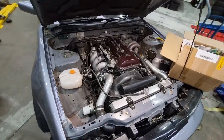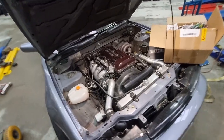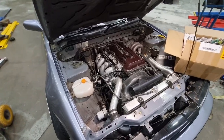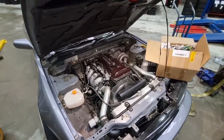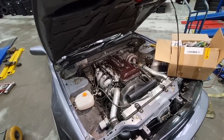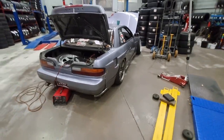The alternator was doing something, I should say. It wasn't like it wasn't doing anything. Idled, it was doing nothing. It would literally start misfiring if I idled for 30 seconds and start breaking up to the point you couldn't drive off. Once you revved it up to like 4,000 or whatever, we maybe got like 11.8 to 12.1 volts in the car. But yeah, not ideal. Anyway, she made it through. We still got second place, so still looking pretty damn good.